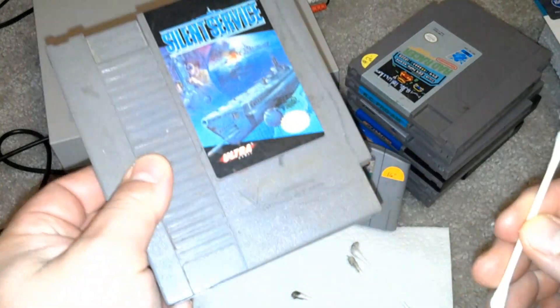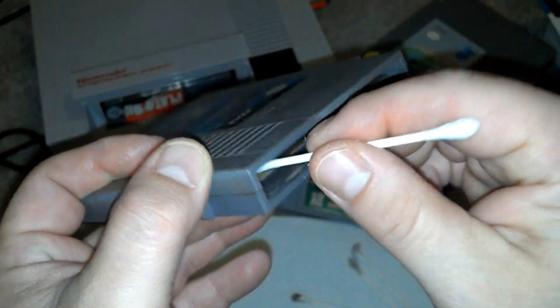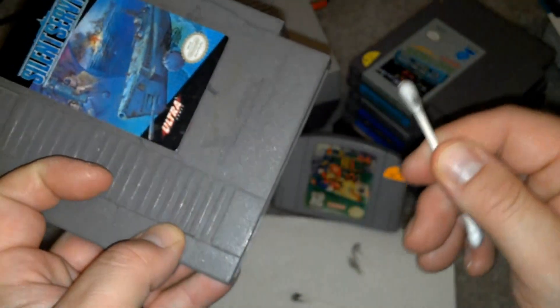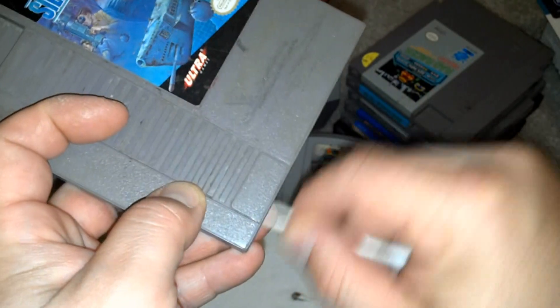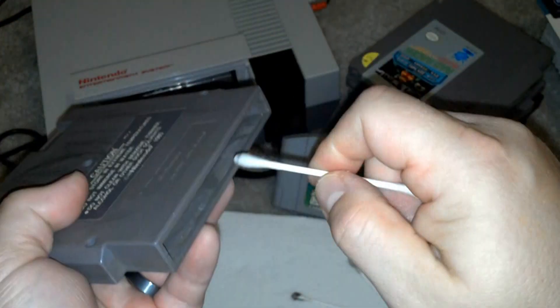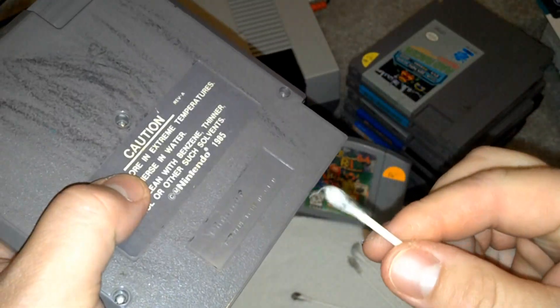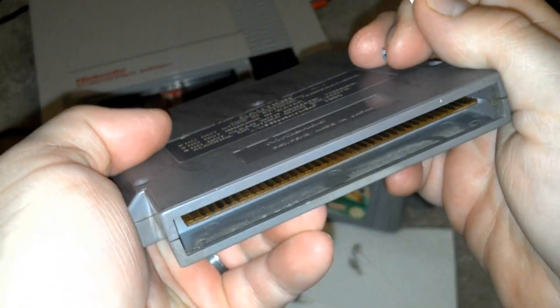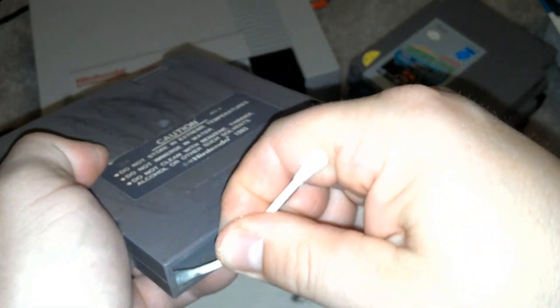Take a cartridge like this — in here you're going to see what look like little teeth. Just hold the cartridge down, scrub it with the wet side, and you'll start to see a lot of the corrosion due to oxidization. You're also going to get the crud off, because as kids we don't store things so well. The teeth are clean now — with the alcohol, it just dissipates very quickly. I like to clean on the inside too — it's like mud in there, it's horrible.